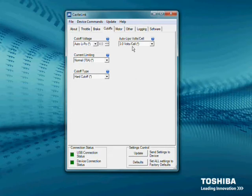I've got a setup that should be able to fly 5 minutes. I'll usually go out for the first flight and fly it for 3 minutes, and then see how many milliamps I put back. Do the math on that, and then I extend my flight time as long as I can. Also take into account, on a windy day, I may cut my flight time by 30 seconds.